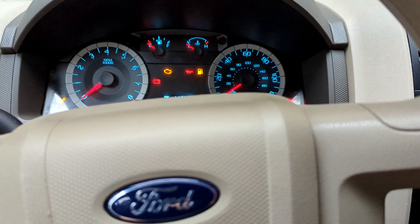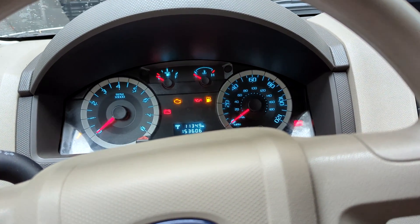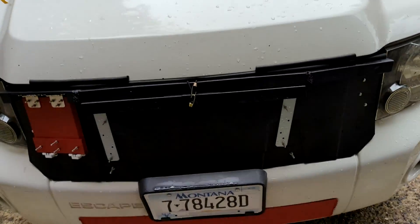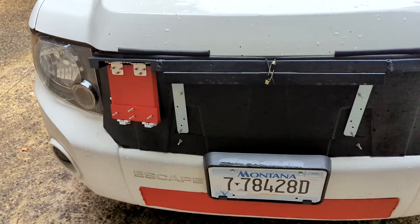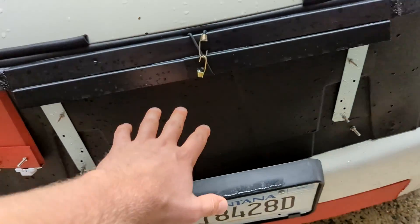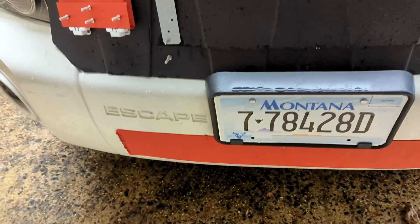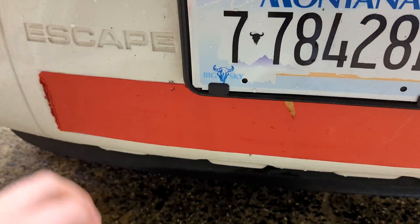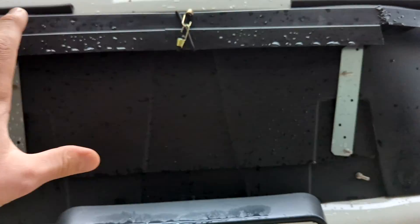It's not as clean and precise as a hydraulic power steering system tends to be. So without any power steering, I really like how it handles. Jumping up front now, you can see the whole front panel looks a little different. I mounted all this aero-blocking stuff, and this is where the radiator is under here, held in with some magnets. This used to be a vent — I blocked that off, didn't need it anymore, better for range.